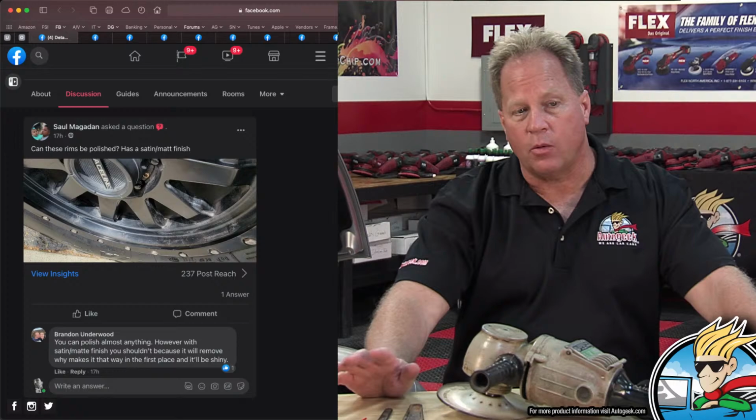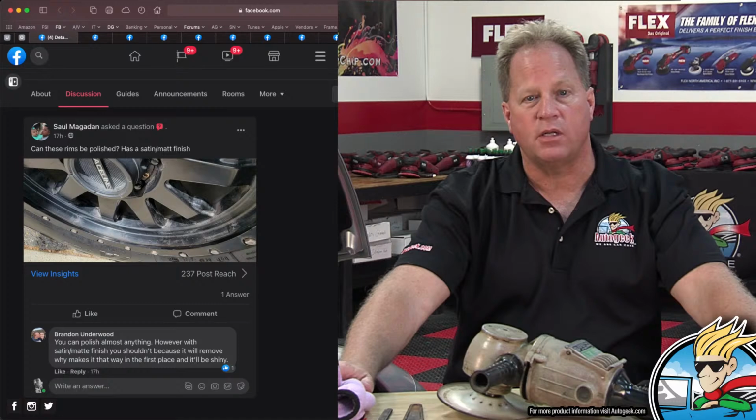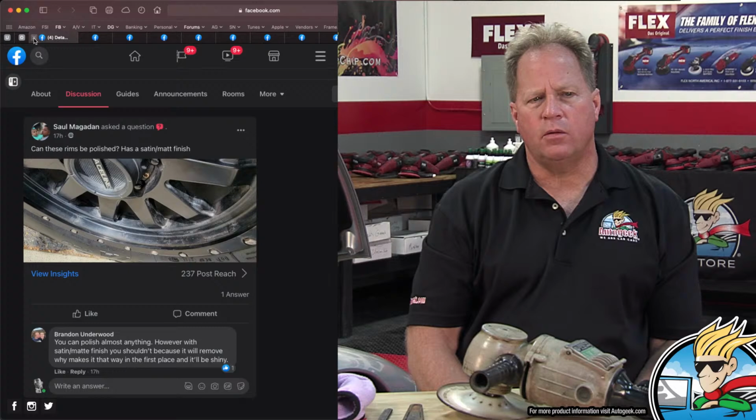But what I would do is I would get a high quality compound and probably a microfiber and wrap your finger around it like this, and then get in there and rub on the sides like this, or if you've been looking for a great reason to buy a Rupes Nano. Other than that, find a real repair guy, buy a set of wheels, repaint them, whatever you can do. This might be a good opportunity to try the rolling Plastidip on it. And repaint. Well, you never know. Powder coat and wheel paint like that is real hard to work on.